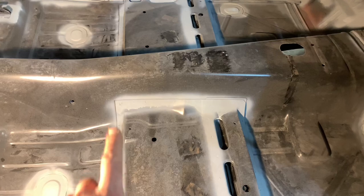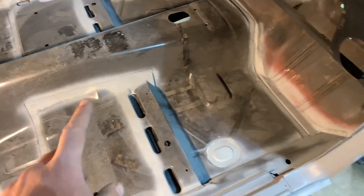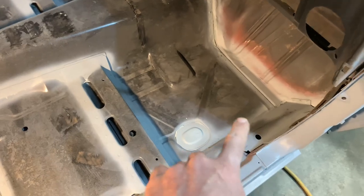Before you do any of the painting, any bare steel — like where I was welding — needs to be covered with some kind of a primer. Then any primer that's more than so many days old all needs to be scuffed. So this has all been wiped down with a Scotch-Brite pad. You remove all the stickers — I've done that. Then any seam sealing needs to be done prior to.